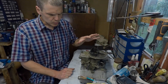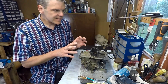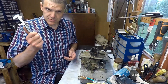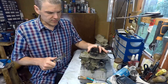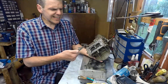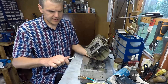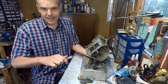On today's episode I'm going to be working on this Holley two-barrel carb — it's actually a special 500 CFM two-barrel from Holley. In terms of two-barrel carbs from Holley, you've got basically two models: the 350 and the 500. You can tell a 500 because it has the largest throttle plates, which are 42-and-a-bit millimeters in diameter.